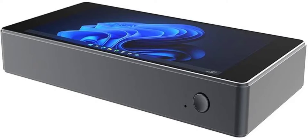It requires just a 30W power input at 12V, which means it may not work with every phone charger. The model has the Intel Celeron N5105 chip with 4 cores, as well as Intel UHD integrated graphics with 24 execution units. The mini PC features a 5.7-inch touchscreen display with a resolution of 1920x1080 pixels.